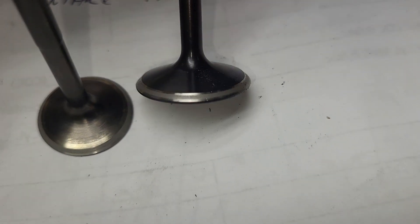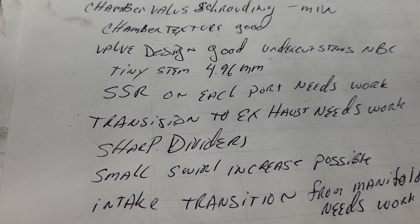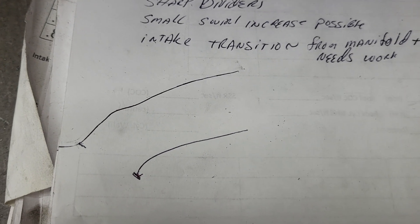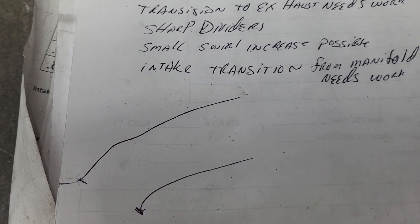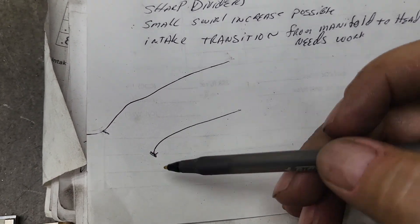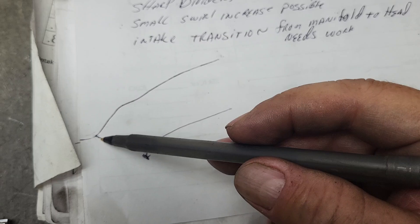The head's got a nice shape to it — that's our intake, that's our exhaust, they're both about the same. I'm going to say about a 13-degree shape on that. Short side radius on each port needs work. You know what, I'll bend a piece of solder around that and show you. Not my usual beautiful artwork, but you can get an idea of how steep those ports are and how well they're already shaped. Does that mean we can't improve them? Well, according to my finger when I first put it on that intake port, I said that short side needs a little work. They came off our bottom cut.